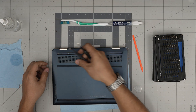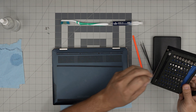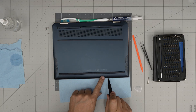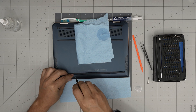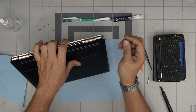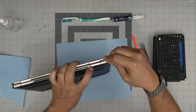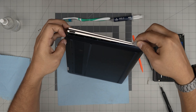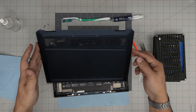Once you remove those screws, use tweezers to bring them up and keep them in one pile. Then grab a Torx number five driver and remove the two screws at the front of the laptop — keep those in a separate pile. Now grab the opening tool and start from the back corner, sticking it in between the bottom cover and the palm rest. Lift it up gently, working around — you're thinking about one or two millimeters of the guitar pick, not sticking the whole thing in. The cover should come out pretty easily once you loosen up the clips.